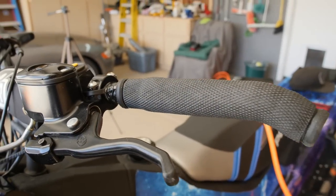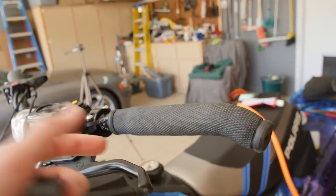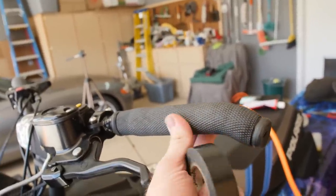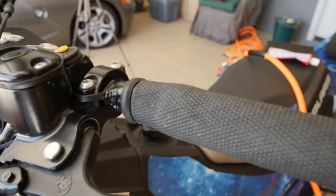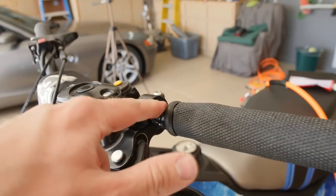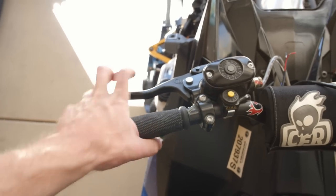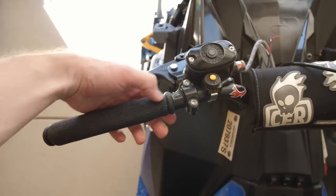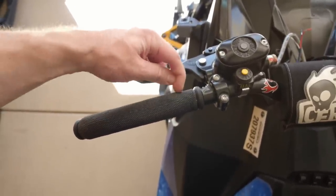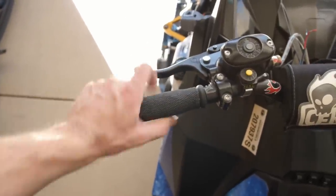We're all good to go on the left side. One thing I forgot to mention: when you install both the cork and the heater, put a little bit of electrical tape on the ends of both so that when you install the grip it's a lot easier to push on. Right here on the end where the wire comes out, I put a little electrical tape just to keep it down and away from getting caught on anything. My hand normally sits right in this area, so I'm not too concerned about the wire being right here. You can tell where the end of the cork and heater is, but it's not in the way.